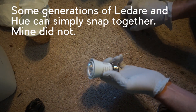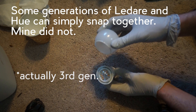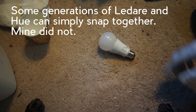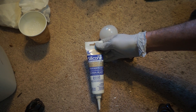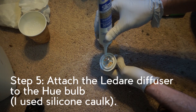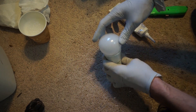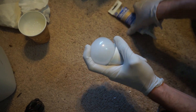The bulb is the second-generation Philips Hue, and it looks like the original ones fit the IKEA bulb better than the new ones do — they won't actually snap in. So you have to seal it with something. I got this Silicone 2 stuff that's usually used for windows and showers, which can work up to 400 degrees Fahrenheit — should be plenty for this bulb. This is clear silicone, and since there's a little bit of a lip I'm going to go in that groove right there also.